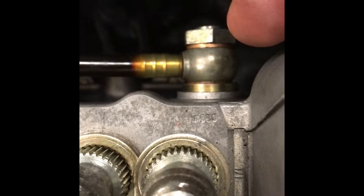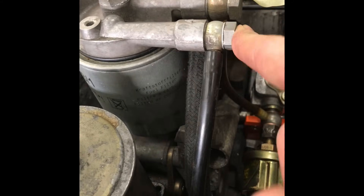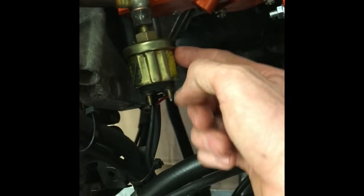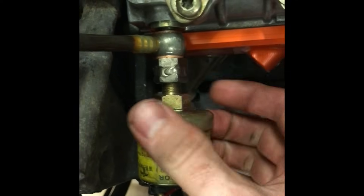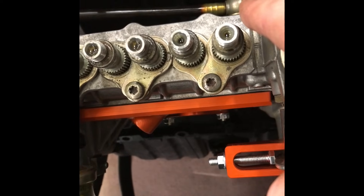Just while I'm putting this back together: standard return banjo that's been drilled out. No special return system on this one — old school, just a banjo fitting filter housing. A Bosch 44 from the tank pushes through a hard line into this, pressurises, and this goes into the pump. This is where the sensor reads — it's just basically a boss that's welded onto the end. The sensor reads the fuel pressure, and that pressure banjo restricts the return so we get our pressure in here, with a reading on what is just an oil pressure gauge I put in the centre console. Works absolutely fine — cheap, easy, brilliant, and effective. No rising rate nonsense where a pipe can fall off and then your system goes totally wrong. It just works every time you switch it on.